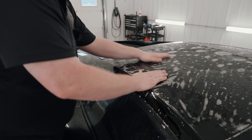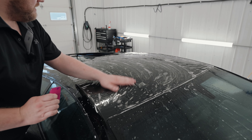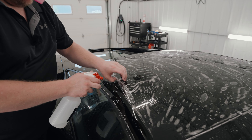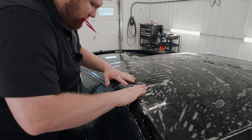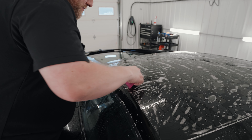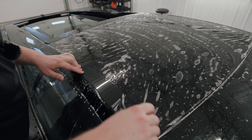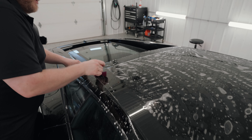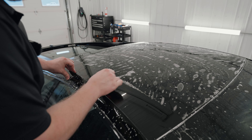Perfect, that's good. I'm going to take my hand and massage the air bubbles out from underneath the film, make sure it's gliding properly. Now I need to pull the film this way a little bit, so I'm just going to pull the film into place and tack that down. Instead of working our way from the middle to the outside, we're going to work our way from the outside to the middle. I always want to make sure I'm overlapping my squeegee strokes.